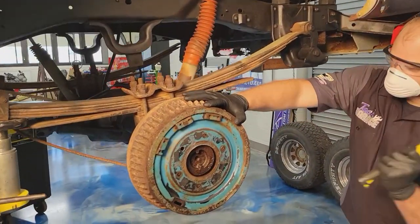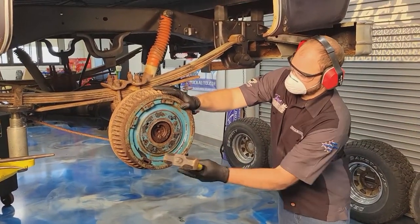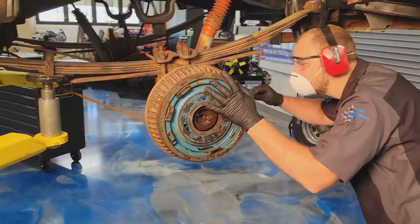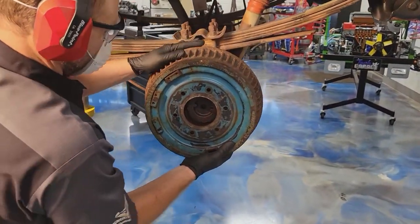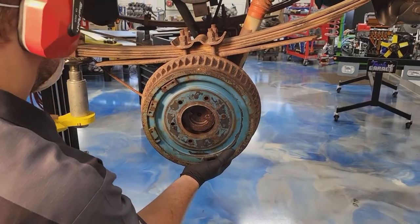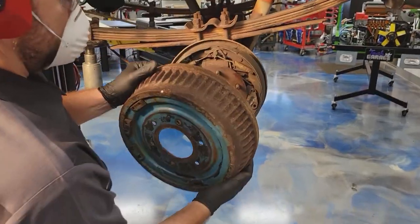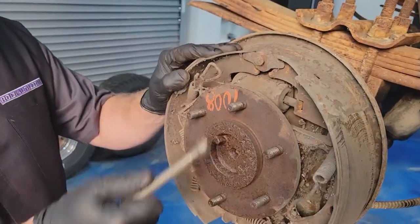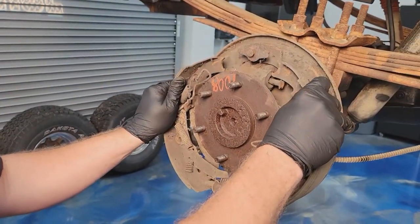It all started in the rear. With an old truck like this, please be careful — there could be asbestos back there. So Dave and I wasn't going to go back there; we sent Josh back there, but he was suited up — mask, glasses, earmuffs, the whole nine yards. He got to hitting on that drum with a big hammer, and after a couple of slams and a few drops of sweat, the drum was free. Once he got the drum off, he went in and stripped the rear shoes off, not being too gentle because we weren't going to reuse them.